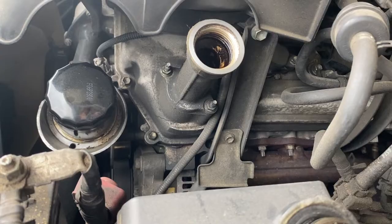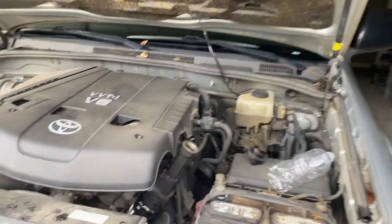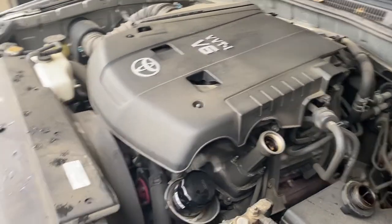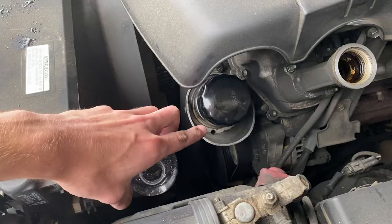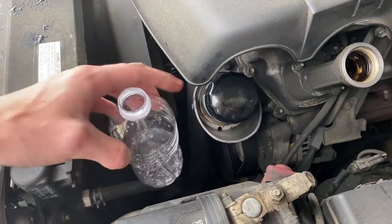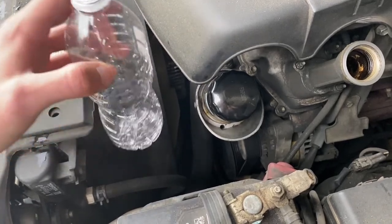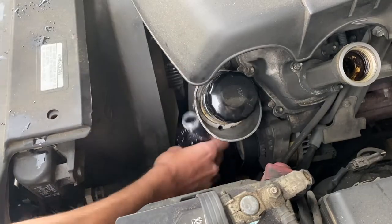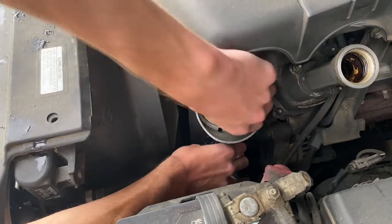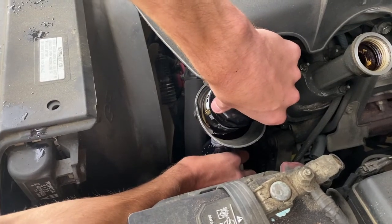I also removed the oil cap to help get airflow when it's draining out the bottom. I just checked the oil at the bottom and it's a very very slow drip, which means it should be a good time to take off the oil filter. The water bottle trick — all you do is get a water bottle and put it where the hole comes out in the bottom, because the oil will leak into it and go through the hole into the bottle. It kind of acts as a little catch pan. Make sure your oil isn't hot because you definitely do not want to melt the water bottle. Just put it on the hole on the underside and then start to loosen it up. As you can see the oil is starting to seep out into the hole and into the water bottle.